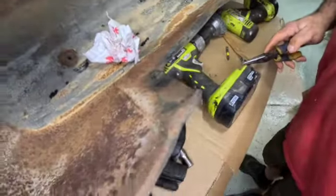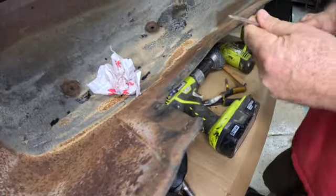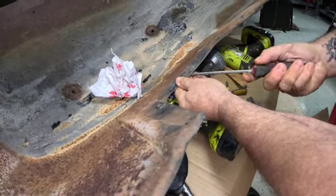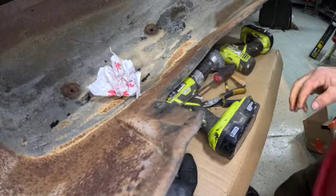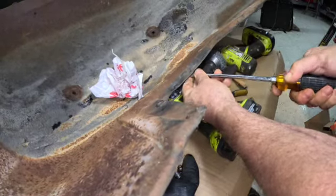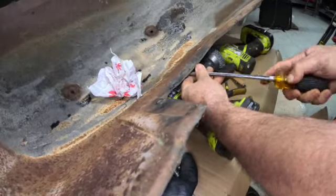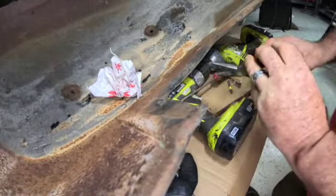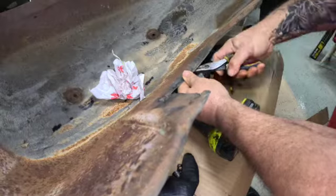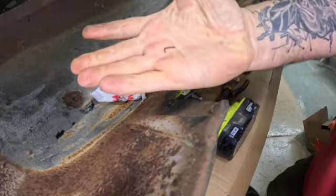So now what I'm going to do — put the camera back down — I'm going to take a screwdriver, a bit of a thin one at first and slide it under. Give it a pry until I've got a little more room, then go for a larger flat blade to get under it and give it a twist. It starts to come out. In this case I might have to use those pliers to pull it out. And there we go — that's what's left of it.